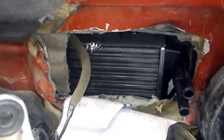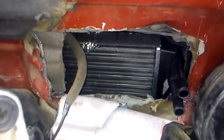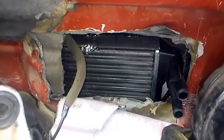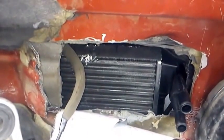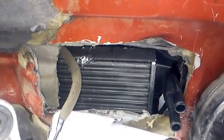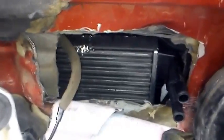I did not have to evacuate my air conditioner this way, so I saved a little money. I've probably been on this thing a whole hour and 15 minutes total. When I close this back up, it's pretty much going to disappear behind the intake and computer — you're not going to see anything. I'm going to cut that big piece off and make a little plate out of a piece of aluminum or light steel that'll flex and go in with some sheet metal screws. After I duct tape and silicone the heater box, it's going to go where it's supposed to. So if you want to save time, not evacuate your air conditioner, and you don't mind cutting your firewall, this is the alternative to getting your heater core out without pulling your dash.